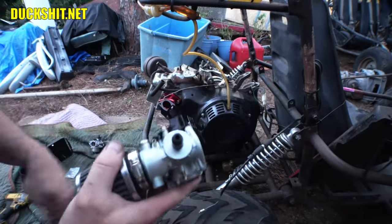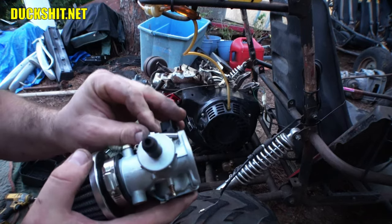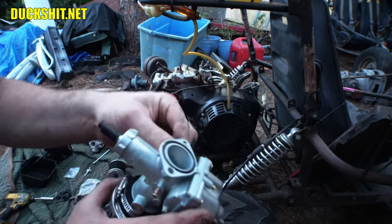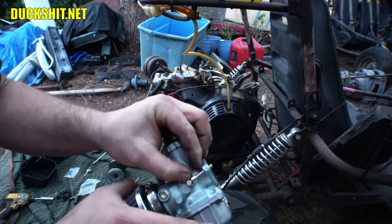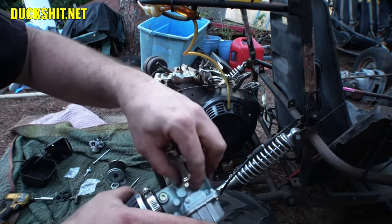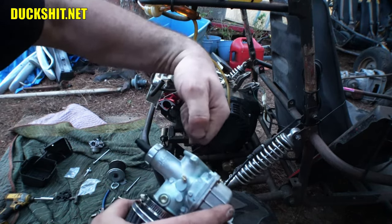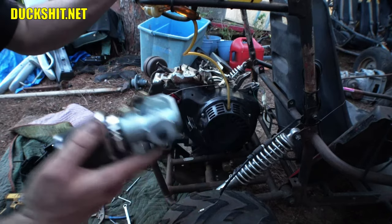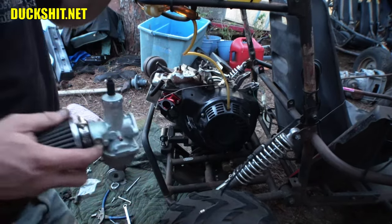All right, wallowing was the answer, because look at that. There we go, the bolt goes right in. I didn't even have to do much to it, a fraction of a millimeter on here. I just put a drill bit right in there, pivoted just a little bit and took a little meat off of it. You can't even tell by looking at it, so it should work just fine.